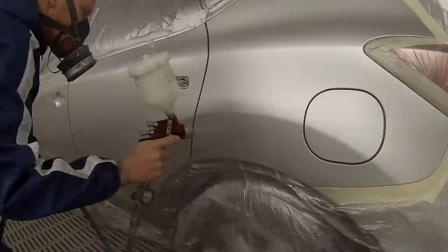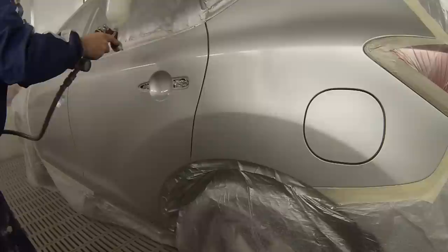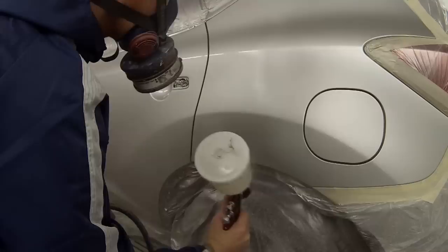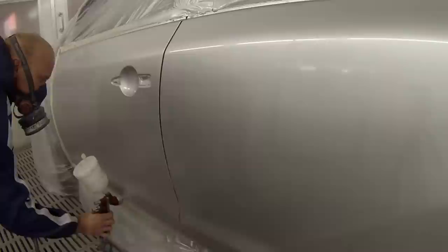Holding the gun nice and close — as you can see these are very efficient guns, there is really not much overspray, so that means that most of the paint is actually hitting the panel which is where I want it to go. Paint in the filters blocks up the spray filters and it means you're wasting more paint and going through a lot more. On to our second coat of clear — you can go on with your second coat a little bit heavier than your first coat.